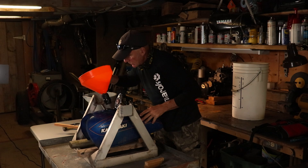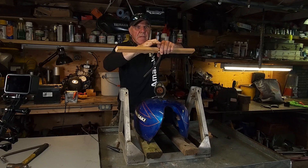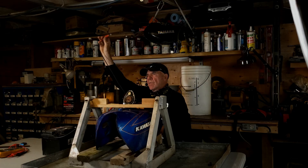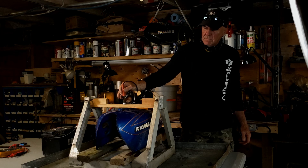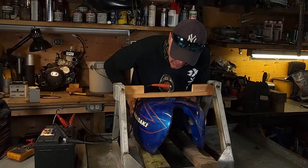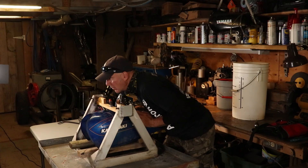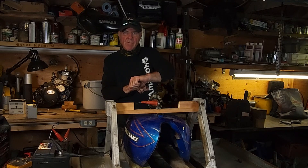Let's get some juice inside this thing. Should be enough. Now all we've got to do is delicately insert the anode. We've got the negative — the cathode going to the negative on the battery — and we take the red positive. Something's definitely happening — got a bit of a boil going on and getting a little foamy in there like a rabid coyote. Must be working. I think I can smell maybe a little bit of hydrogen, so probably a good idea to leave that door open. Come back in two or three hours and we'll see where we're at.